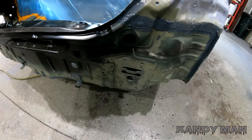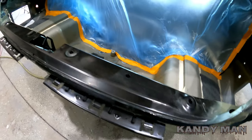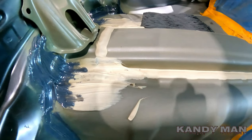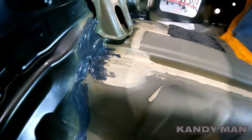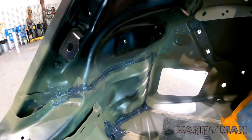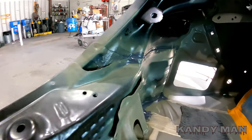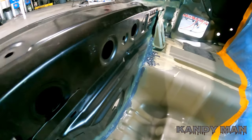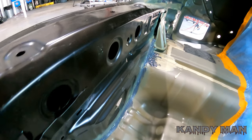Here's the job I'm talking about — we put a rear body in this car and we used a two-part seam sealer inside. But you can see the original is like a beige and we don't have that at the moment. I'm going to show you how you can do something with that to make it match, because we like to go with the factory look when we do our cut-ins — make it look like it's factory even if you don't have the right seam sealer.